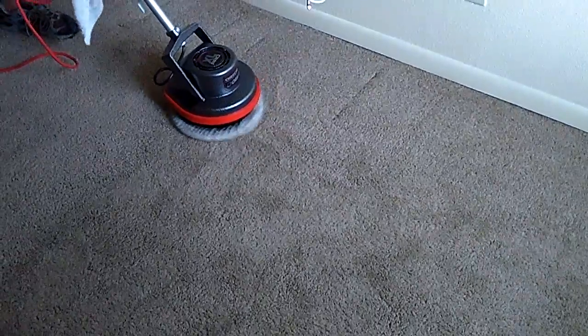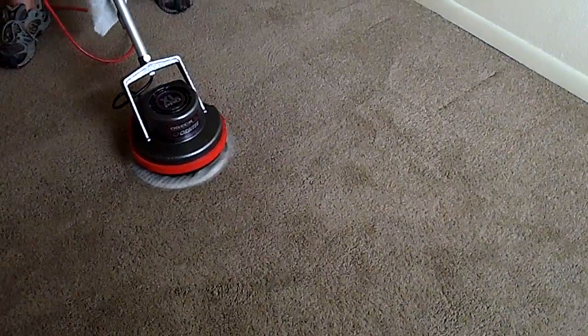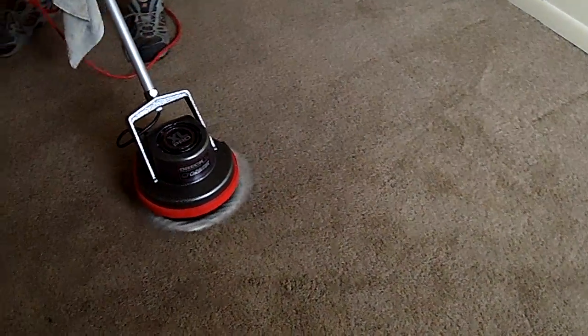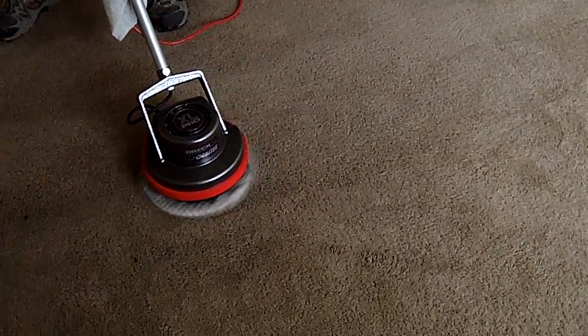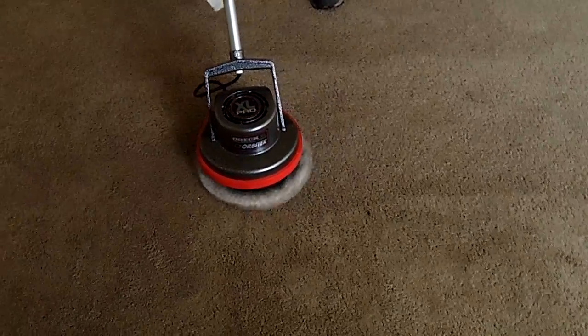And they make a bunch. There's only 3 wires. Yeah, there's only 3 wires. But there are a few different relays depending on the model, so you want to get the old one off if you need to replace it and get the numbers off of it, so that you can go get your part that you need to replace it.